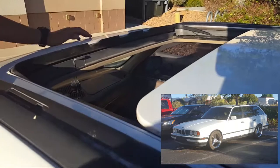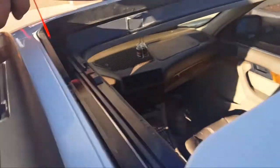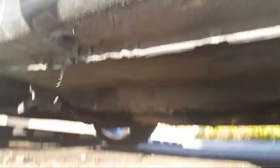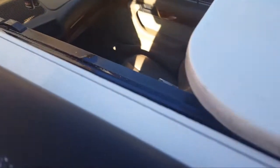All right, today we're gonna lube up the sunroof. These panoramic sunroofs, they like to seize up on us — really tricky. So we're gonna clean the old grease out of the rails here. You're gonna see there's a nice drain way back in there, which actually drains under the car. And there's that old, nasty grease.